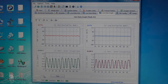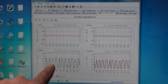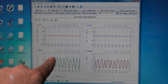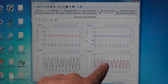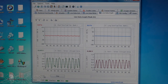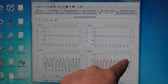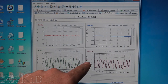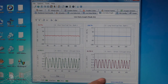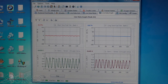Since there are no problems with the fuel trims on this car, we can just go ahead and believe what our oxygen sensors are telling us. This oxygen sensor comes before the catalytic converter — it is supposed to be oscillating up and down. The second sensor, sensor number two, comes after our catalytic converters and is not supposed to be going up and down — it's supposed to be straight across, a little bit rich, maybe around 0.6 volts. The fact that we see both O2 sensors behaving similarly is sign number one that our pre-catalytic converter is dead.